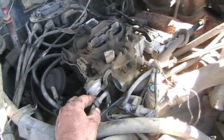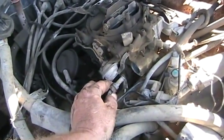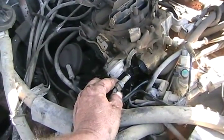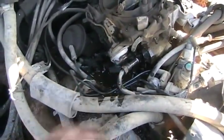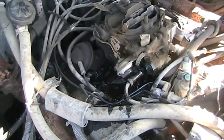You don't have to touch the gas pedal. It won't start because I've got the big red wire to the distributor unhooked, so there's no spark for safety reasons. I'm out of the way, I'm clear. She's flowing really good. Fuel's not as orange as I thought considering the rust, but that's probably just from sitting and settling down.